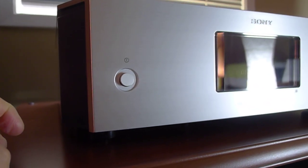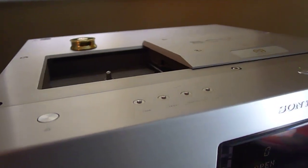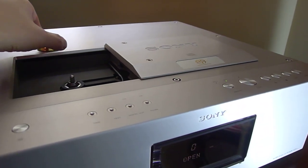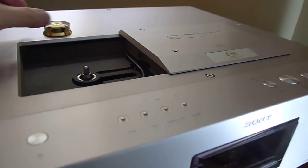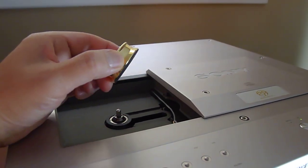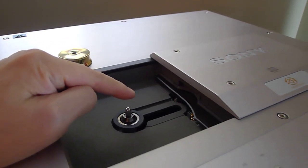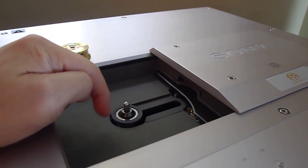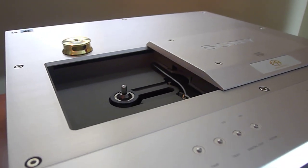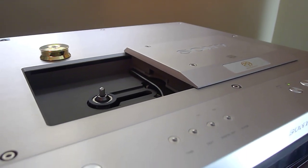There's an extra foot in the center, and also the digital and analog power supplies are separate. This one also has XLR outputs. This unit uses a balancer for the CD and has two CD lenses — the CD itself moves instead of the lens. One lens is for standard CD and the other one is for Super Audio CD.